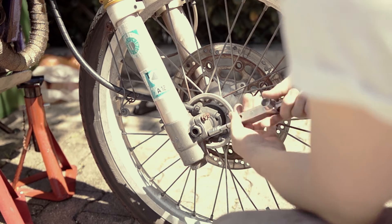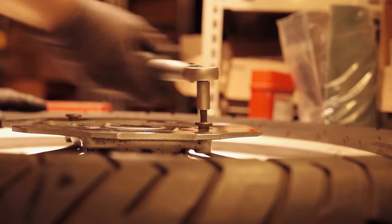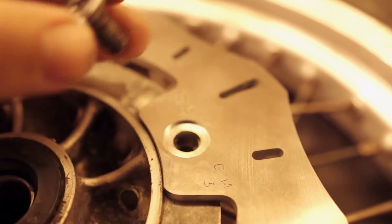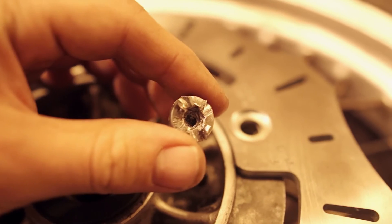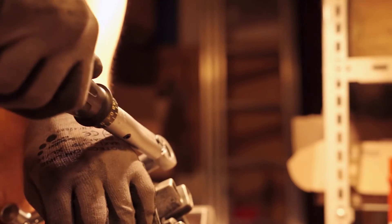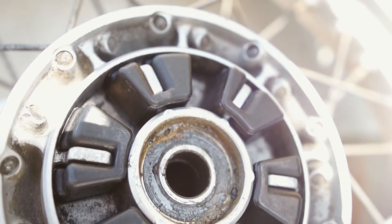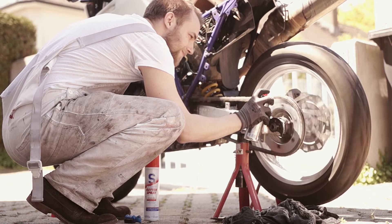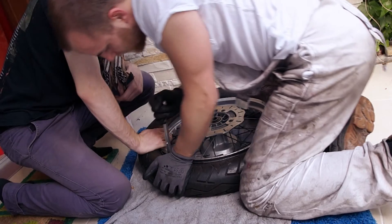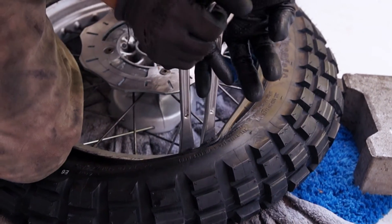Now I took care of the brakes and wheels. I had to replace the disc in the front and rear. I had some screw issues here as well, but using the same technique as with the alternator inspection cap I was able to remove it. I also installed a different chain wheel with 43 sprockets and of course new brake pads. I also had to fit new rear hub absorbers. Then I cleaned the oiled chain and installed the highly recommended seal retainer. I switched to dual sport tires — I've never tried those specific ones, so I will have to report back.